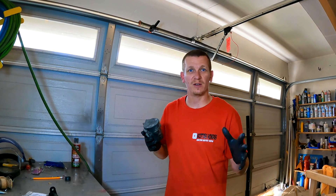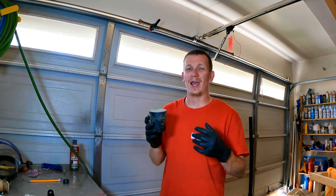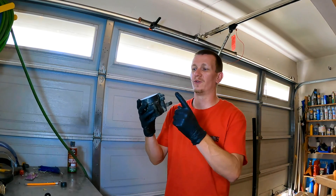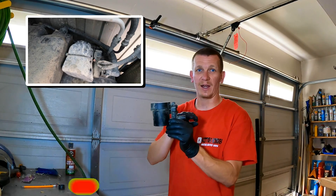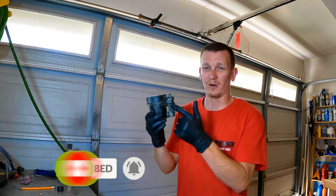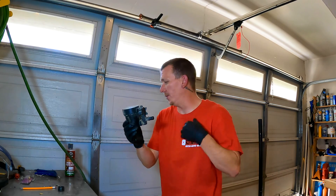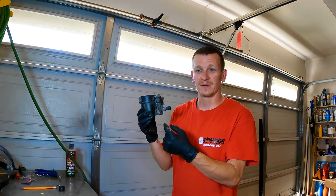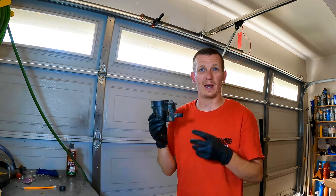This van is used for Amazon delivery packages, so this solenoid is used a lot. What happens is when the vehicle is turned off, or when there's no voltage applied to the solenoid, it is open — allowing air or vapors in the emission system or fuel system to be released into the atmosphere. With no power applied, you can breathe in and out of this.